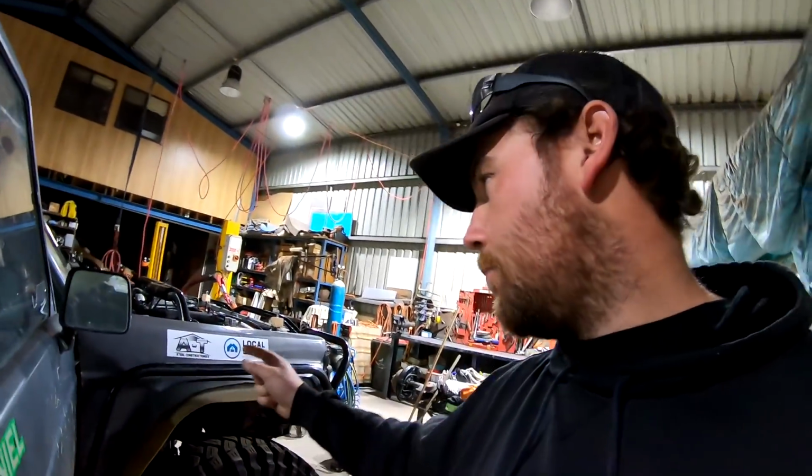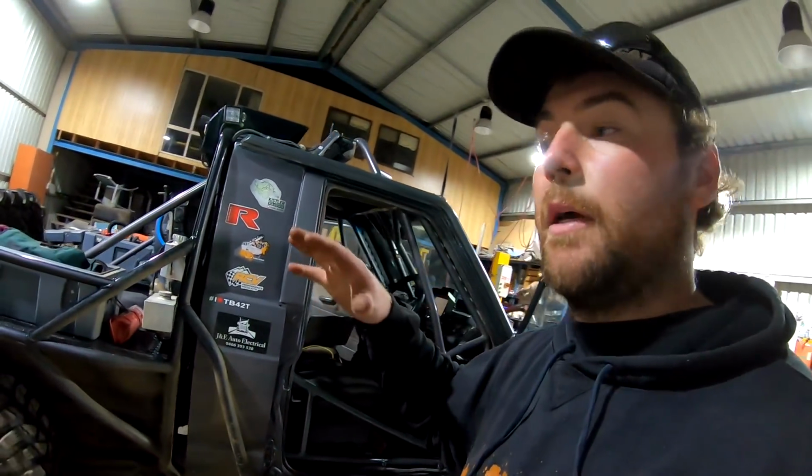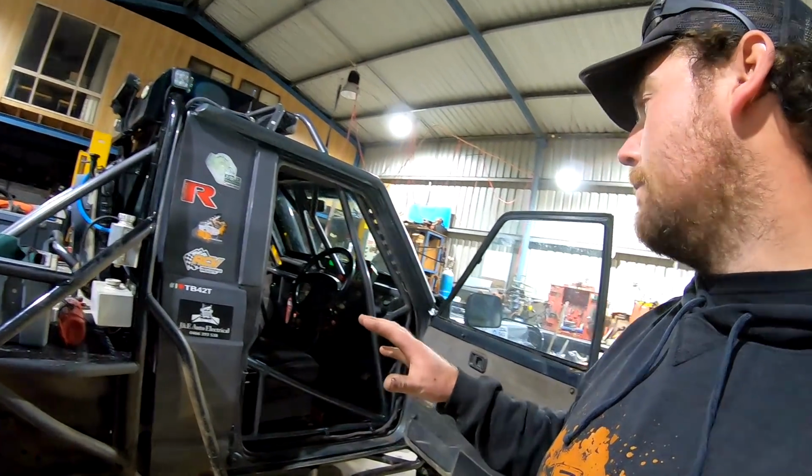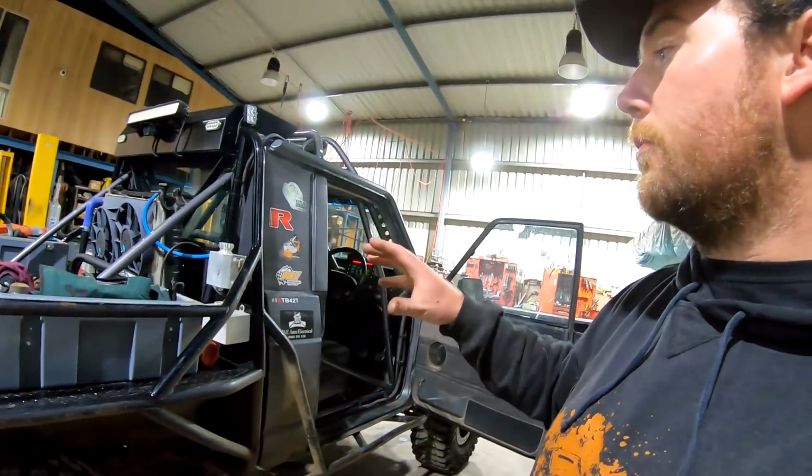And I just got to go over the pressures in the bum stops and the coilovers all round. Just re-gas them, make sure they're all at pressure, and mainly the bum stops. But it's good just to check the coilovers, make sure they're all good.